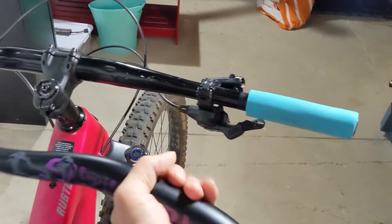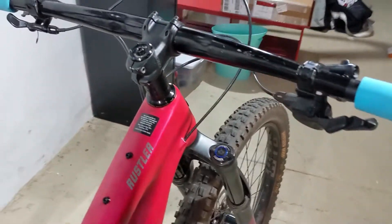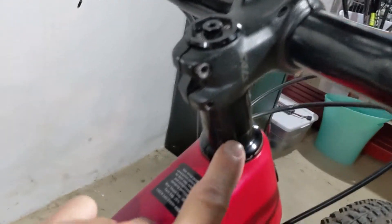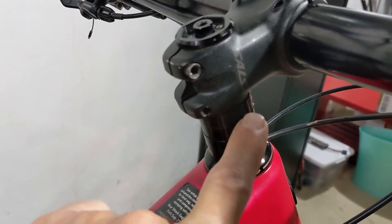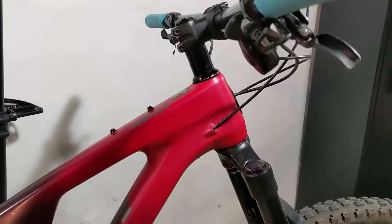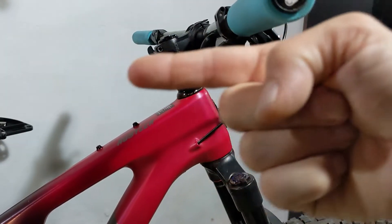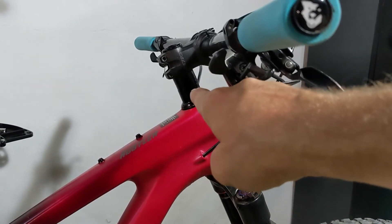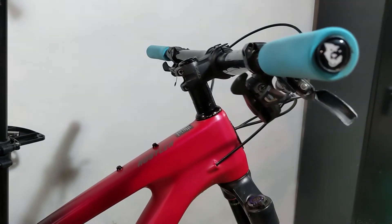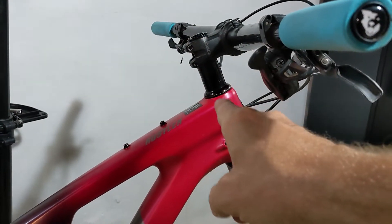These bars are actually in a pretty good position, so let me explain this a little bit. What's going to happen is I want to lower the stem down and get rid of some spacers. I really don't like having a ton of spacers, because due to your head angle, when you have more spacers, you're actually moving the bars back. And if you really look, they move a lot — half that distance is probably a good 10mm forward. So if you're trying to raise your handlebars, this is the wrong way to do it because then you shorten your cockpit.